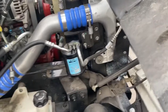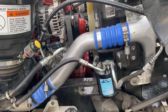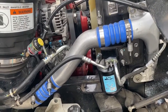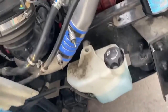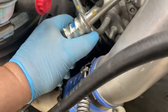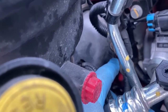I hope this helps you guys out, man. This is the basic checks on AC — you can do this on cars, RVs, any vehicle. This stuff's no different; they all have compressors, condensers, evaporators, and expansion valves. The only thing different is some have different sensors. There's two sensors on this one right there on the high side. One is pressure and one is temperature, I think — you'd have to look at the manual. One of those sensor indications is that it knows when the pressure of the Freon has to be a certain amount; it knows how much Freon's in there. So if it's low on Freon, the pressure's not going to come on, protecting the compressor.